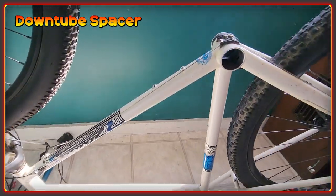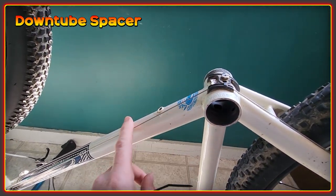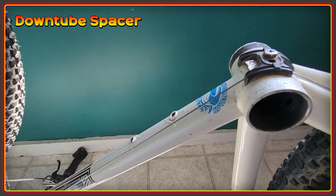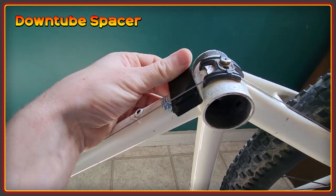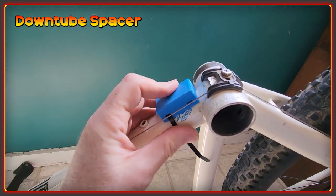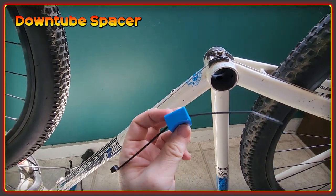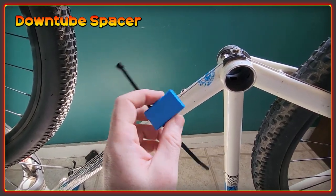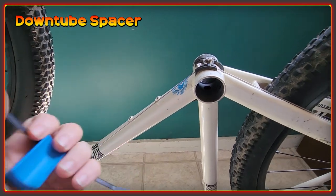The first thing I notice when I put it on is that it's going to be impinging on my gear cable that I use to change the gears at the back. CYC sent a plastic part apparently for this purpose to separate them, but it's not really going to work for me. So I've 3D printed something to go in place of that and I'm going to zip tie that on as the very first job. If people want one of these to fit their bike, buy me a coffee and I'll adapt the design and send you the file so you can print it yourself.